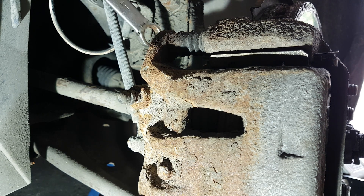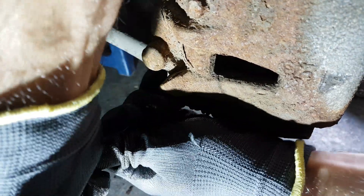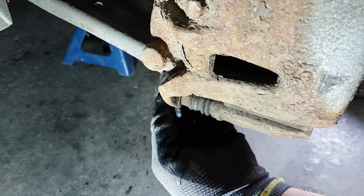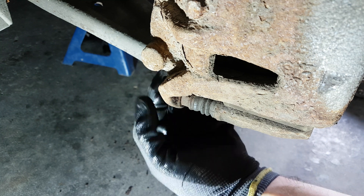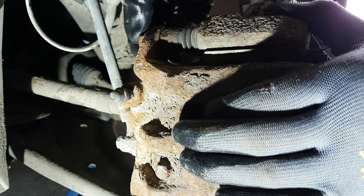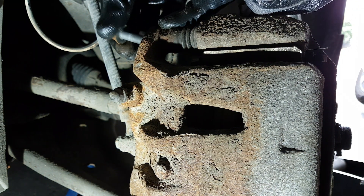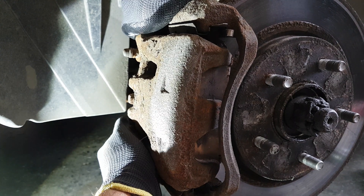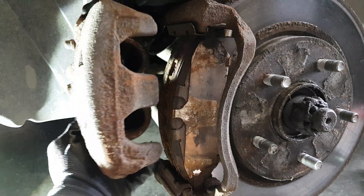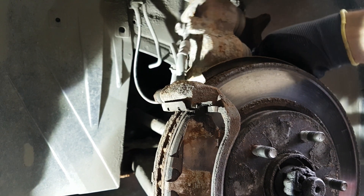You're going to need a 14 millimeter wrench to remove the slide pins and free the caliper. There's one at the top and one at the bottom. Once the slide pins are removed you can try to remove the caliper. Keep in mind that the pistons are on the opposite side, so if you need to press the pistons you just have to pull the caliper towards you. Just make sure the car is stable on a jack stand. Attempt to place the caliper on top of the hub to avoid putting tension on the brake line.